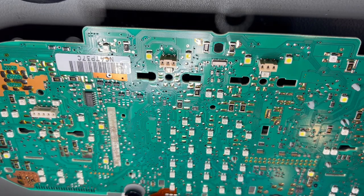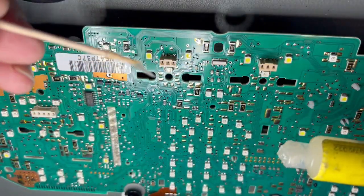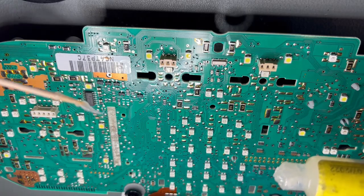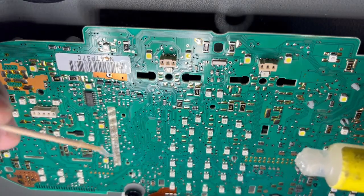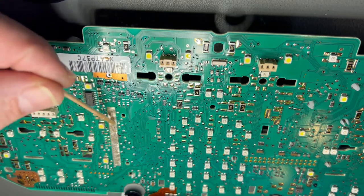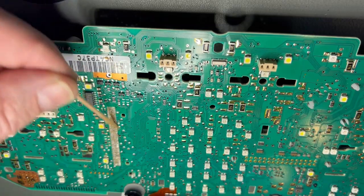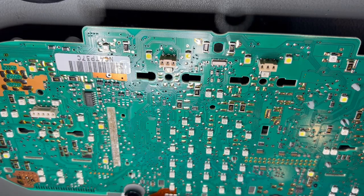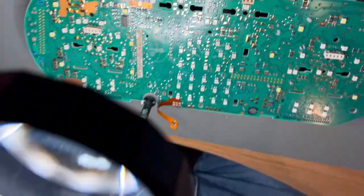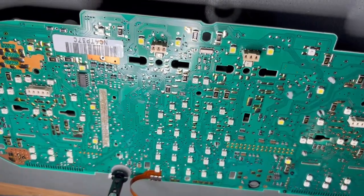What I normally do is use a little bit of flux — it comes in a syringe in paste format — and I use a toothpick to apply this flux along the ribbon area. This allows the solder to flow nicely on the pad and gives a nice mounting surface for the new ribbon. It also means it's easier to remove any remaining fragments of the old display. It's not an issue how much you put on — we can clean this off with some PCB cleaning solvent later. I'm using a bench magnifier to see thoroughly how to do this. You can do it with the naked eye, but there's more risk of getting a solder short.